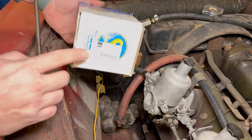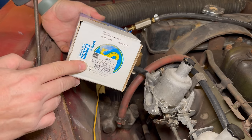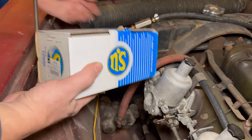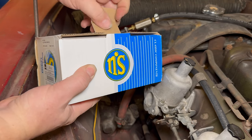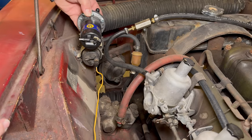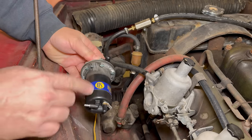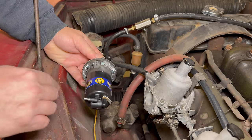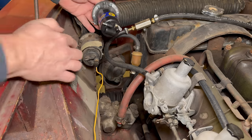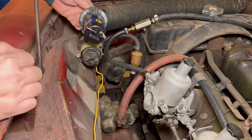I'll be replacing this pump with a new one. This is also a points-type pump in appearance, but it's actually been upgraded with electronics inside of it — so instead of points, it has transistors. This is going to look like the proper type of pump that belongs here, but there is nothing to maintain — no points to clean, it will always just work. So it's pretty simple: just swap it in the clamp, hook the hoses up, and hook our power wire back up.